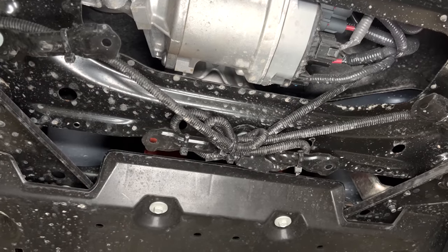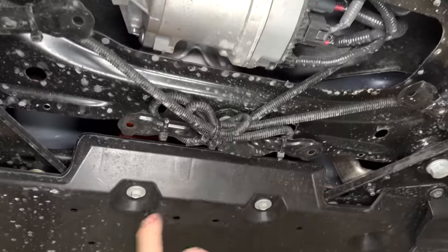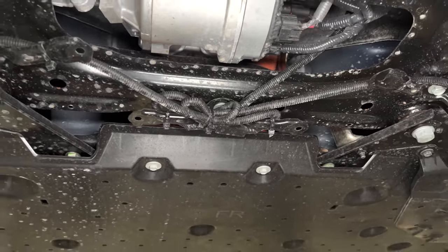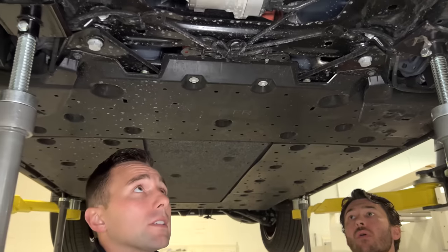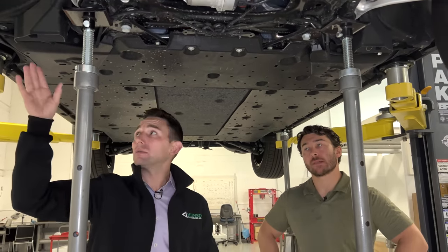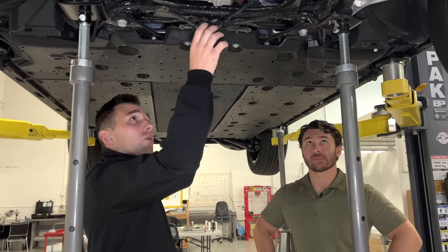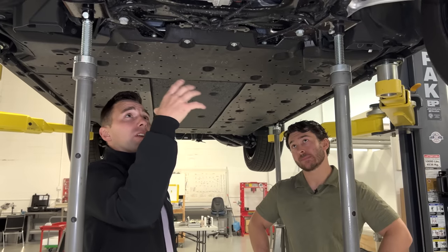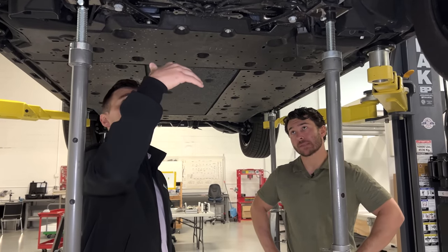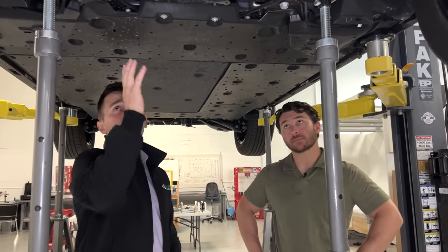Like I know on a Ford Raptor, right? You'll have the loop for all the accessories, and they will deliberately give the customer extra space or extra length in order to attach various features, lights, winches, things along those lines. That's not the case here. So either it's a dealer installed item, could be, right? These lights, and so they're trying to wrap around here. Or it may very well be a manufacturing or decking assembly driven item, meaning the cradle might get decked, then they bring the harness in, and then they wrap it around. Either way, just kind of an odd thing.